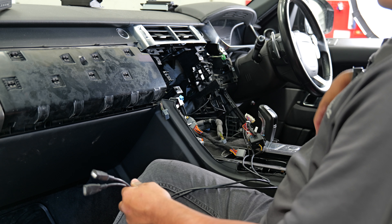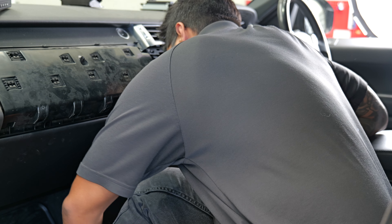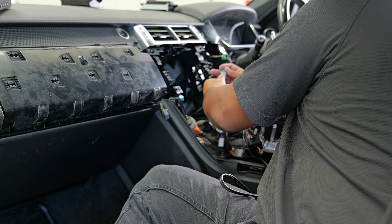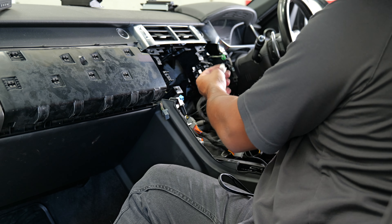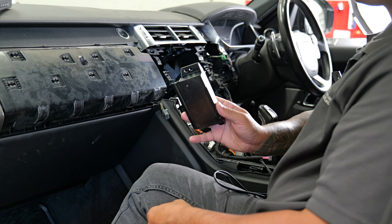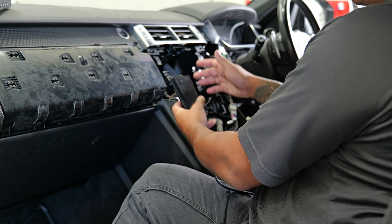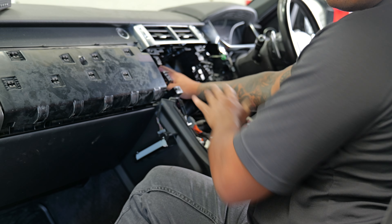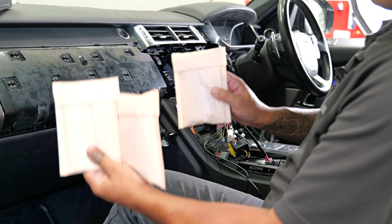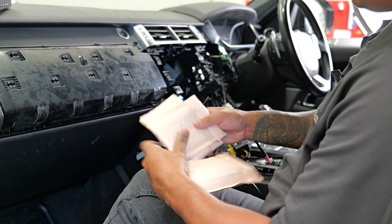There's a cooler box in the center console and CarPlay runs wireless anyway, so just go straight into the glove box — nice and easy. This plug here grabs the original plug from the touchscreen buttons and plugs right in, then goes to the new screen. The original panels just get set in behind the dash so they're retained but tucked away, hidden out of the way. Get that done and then mount your three antennas: GPS, Wi-Fi, and microphone — you have to do all three.